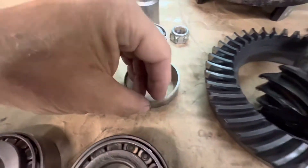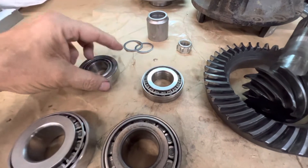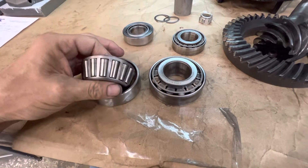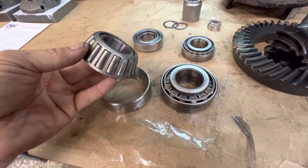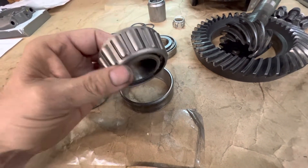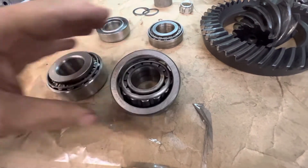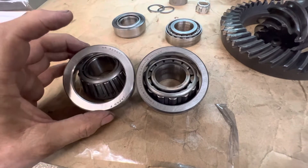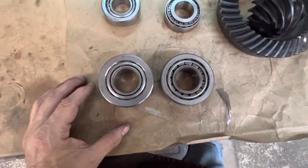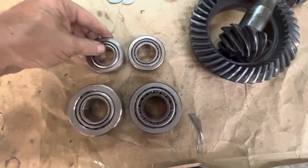You can see it's not as heavy duty, it's just not right. It fits, yeah, but not really that great. Here's your inside bearing — your big bearing. The factory bearing has 16 rollers, and this Timken bearing has only 15 rollers — not as good, not as heavy duty. You can definitely see the physical difference between these bearings.